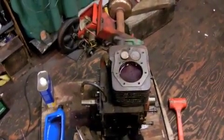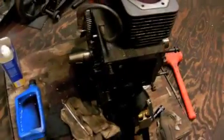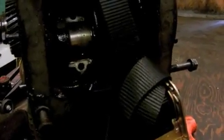Well, my dad and I got a pretty fair amount done on the Onan engine that was on the Welder generator. Got it stripped down quite a bit, got the timing gear covers off, and cleaned all those out, got everything sprayed down with oil. As you guys saw, there was a lot of surface rust just from moisture for the most part in here.